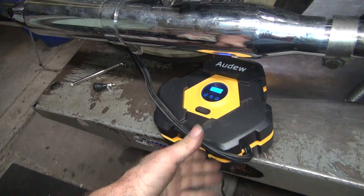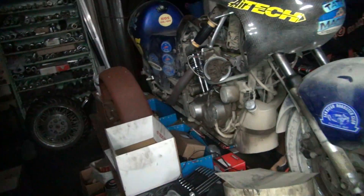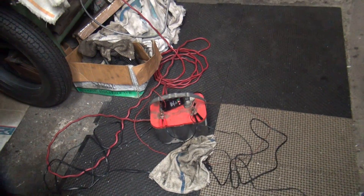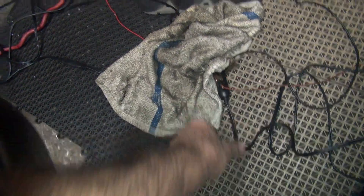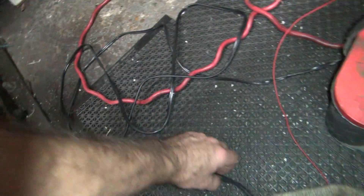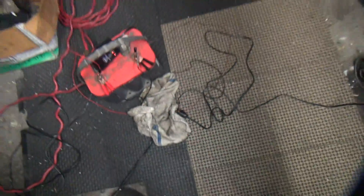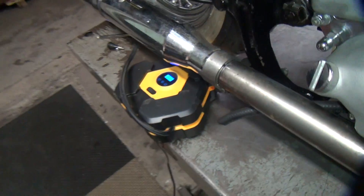It's definitely hot, hot, hot. So that's pretty good — I'm happy with it. It seems to work. I'll put it over with my race bike stuff. When I go to the track, I'll throw it in my junk pile and take it with me. That way if my front or rear tire is low, I can jack it up real quick — without a power adapter, I'll just use alligator clips. It'd be nice to have a 12-volt battery power adapter to hook it right to it. It doesn't take much to do that — cut this thing off here and get a set of leads like this. Every battery charger has a set. Get one of these quick disconnect plugs, hook it up, and get rid of that stupid cigarette lighter thing. You've got an alligator clip that hooks to any 12-volt battery. That way you can make it motorcycle friendly — right now this is not motorcycle friendly, it's car friendly.